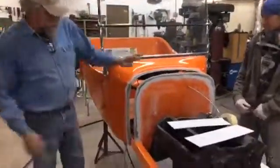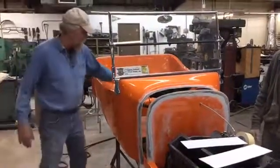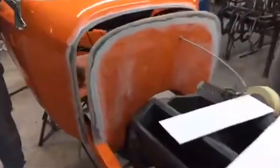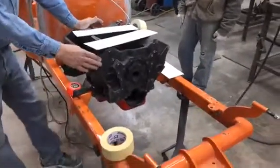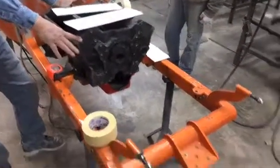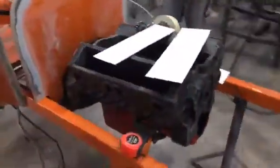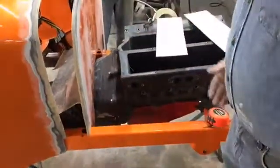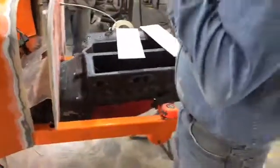So we cut this out, kind of worked it, we figured out where we wanted our 4 inches, moved the frame. I've got the body bolted down. I've got the bolts in the holes where it goes, so the body's there. Body's where it was. Frame is moved forward. Ultimately, we're going to want to move this motor back a little bit because he's added a blower to it, and he'd like to have another 1/2 inch. So I put up a mock-up motor here to make sure we got room when we do this, which we will. So we'll move the motor back maybe 1 inch, 3/4 of an inch. That'll give us plenty of room. We had room in the radiator, but it was close.